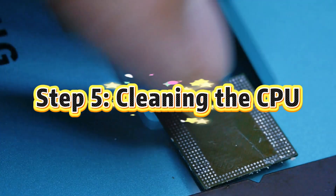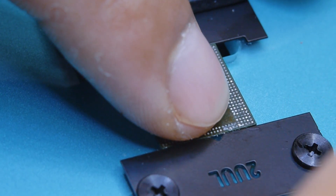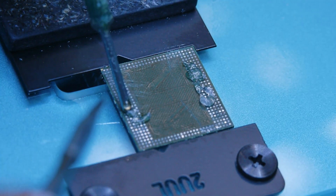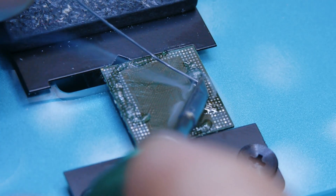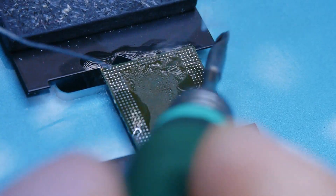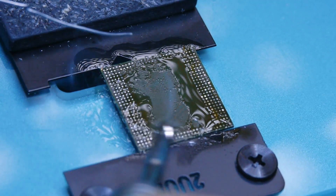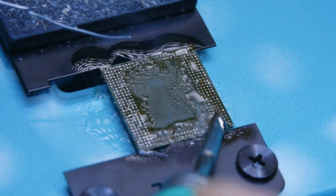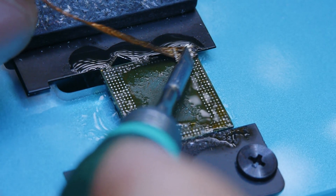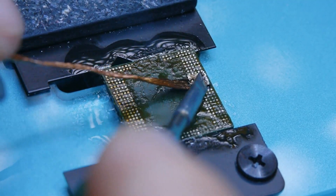Step 5: Cleaning the CPU. Let's clean the CPU starting with the top cover, which includes the RAM. Apply low temp solder and quickly drag with a soldering iron — don't stay in one spot too long or you risk overheating the chips. Android CPUs are more heat tolerant, but Apple chips are very sensitive, so develop the habit of moving quickly. Use the braid to flatten the pads. Work in a tap-and-lift rhythm. Wipe clean with PCB cleaner and get rid of any remaining adhesive.